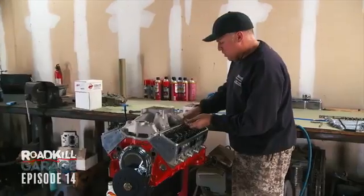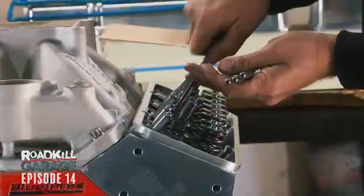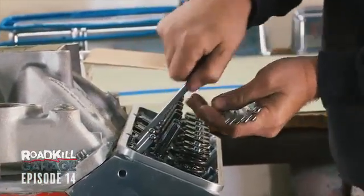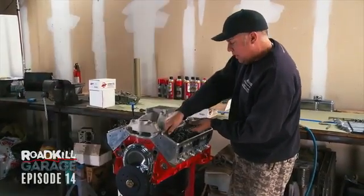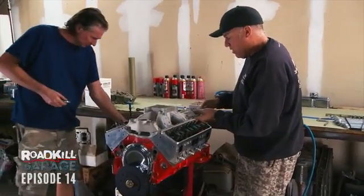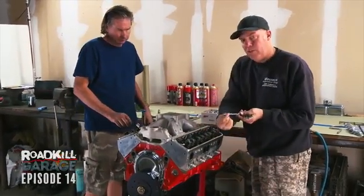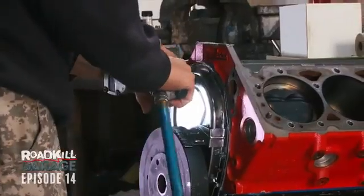You'll see a lot of people say don't touch an engine with an impact wrench. Obviously, we're not following that rule. However, as we take it apart, we'll carefully inspect as we go, just doing sort of a necropsy to find out if there's anything that's been going wrong on it, one of which we just discovered: it doesn't have hardened push rods in it. You have to have hardened push rods for use with guide plates, or the guide plates will ultimately eat the push rod. Can you see any evidence of... They're not chewed.